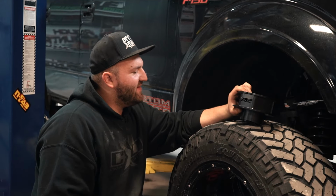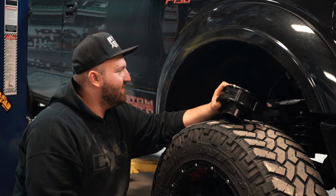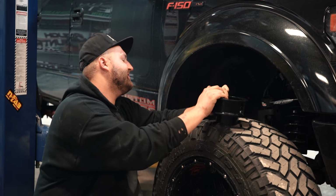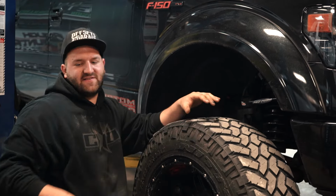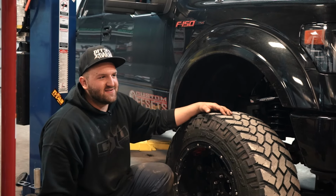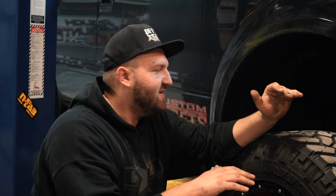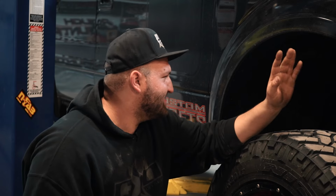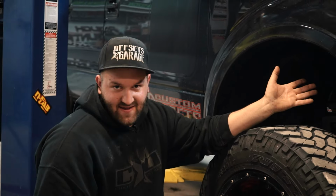So he then took that lift strut and added this 2.5-inch spacer on top of it, which is just a leveling kit. It's a 2.5-inch leveling kit that he put on top of the BDS strut. So he basically went back to kind of the same thing that he started with, except a different form. Rather than having a stock strut with a large 6-inch spacer, he used a 6-inch lift strut and now is just using a 2.5-inch spacer on top of it. And so raising his total lift height to 8.5 inches.